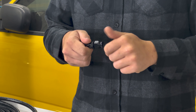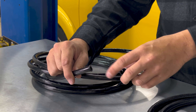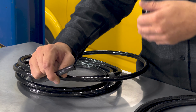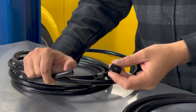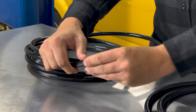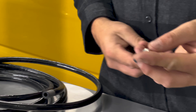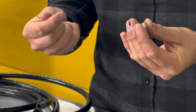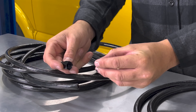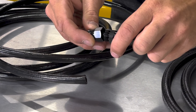Your PTFE line, on the other hand, has one more component to it. You slide the B nut over the OD of the line. I'll note that on these nylon-covered lines, you actually have to cut the nylon back and expose the stainless braiding — it's a bit unsightly and takes some getting used to. Then you slide the B nut past the line. From there, you have a ferrule that you basically sandwich between the PTFE section of the hose and the outer braiding. Once you have it wedged in, you slide the B nut back and the fitting goes on the ID of the hose — sandwiching the PTFE between the inner and outer layers.